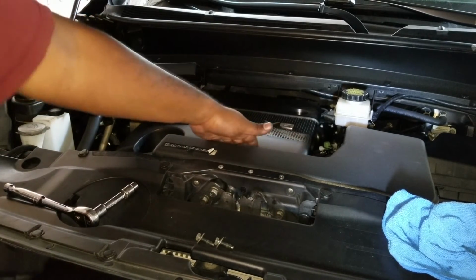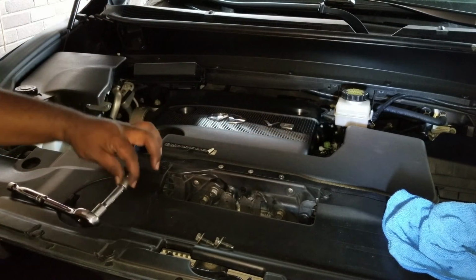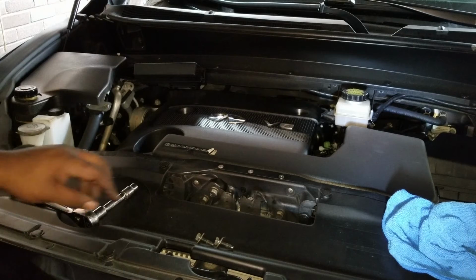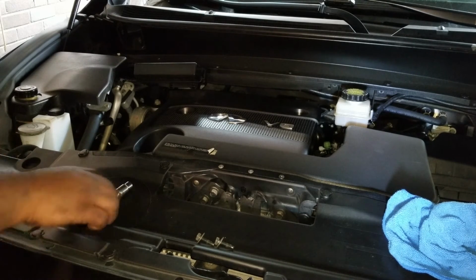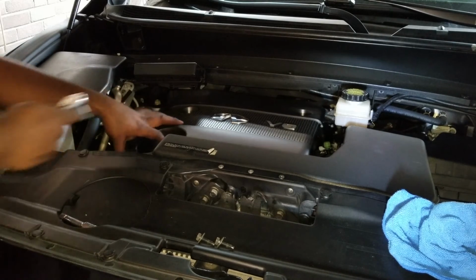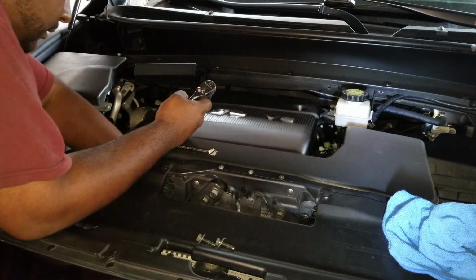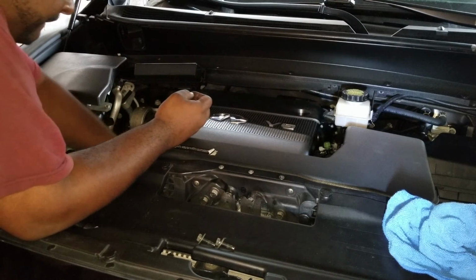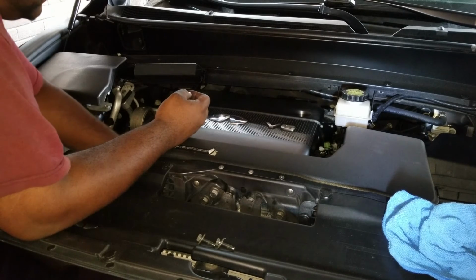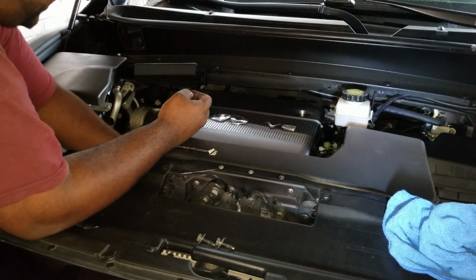So now, same thing as before, 4 bolts. This one back here, you use the wrench for it. I use the socket and the ratchet for the one under here, and then an extension for up here. So I'll do 2 here. I'll just do this one down at the bottom here. Carefully, don't cross thread or anything. This one I would go no more than hand tighten.